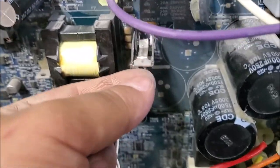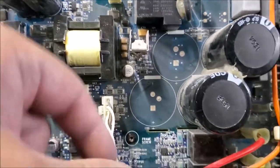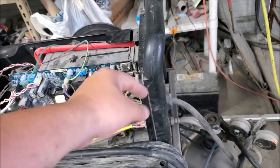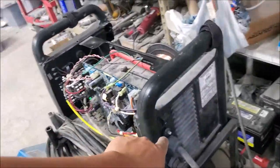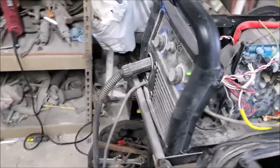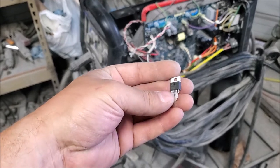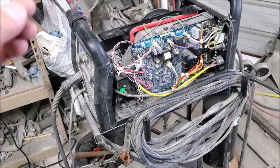As for this piece here, I have it clamped onto the transistor. I'm not sure if that's exactly how it's supposed to go, but I did it because that's how it was before. Like I said at the beginning, I turned it off, then turned it back on — boom, huge explosion. But it works now. I'm still a little afraid of it when I turn it on, but there we go — it just clicked on and it's on again. It was completely dead before. This is a transistor switch, so without it you won't be able to switch your welder on and off. Hopefully this helps you guys out — until next time!